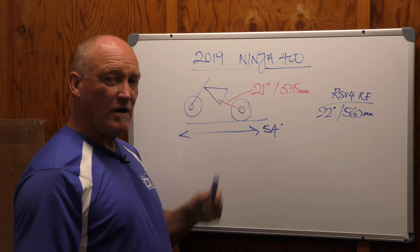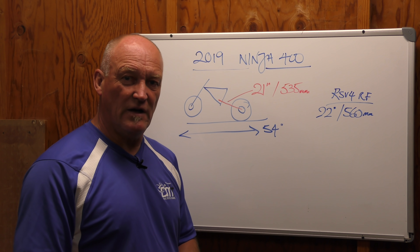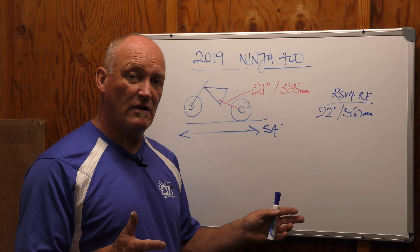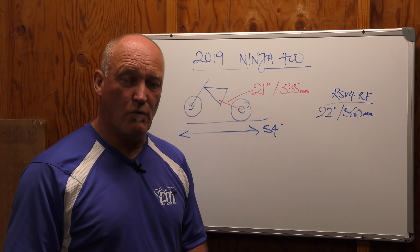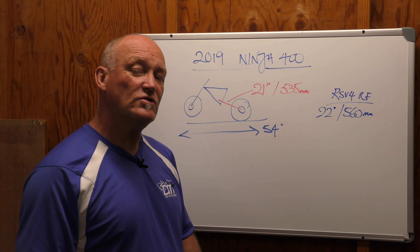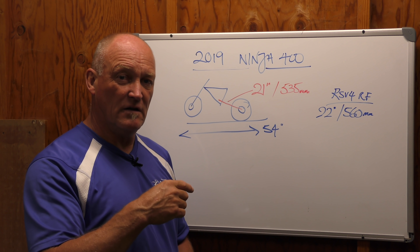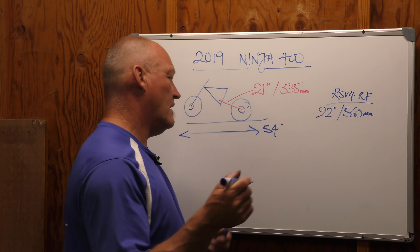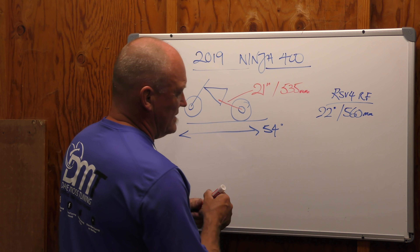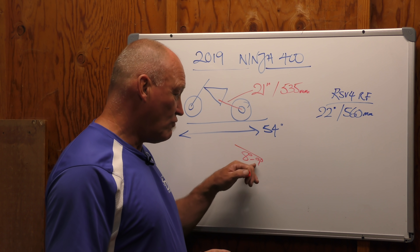So the position of the axle in the swing arm is a very critical factor you need to be aware of. Rule of thumb — generally in the middle is always a good place to be. If you're building something for the track, you're looking at something that needs to be both agile but geared correctly. For that, you may need to go way beyond the stock chain and do something considerably different. With a low horsepower bike, a short wheelbase is fine because you can't put enough leverage through the swing arm and the shock working together to create an issue. That issue is that you never want your swing arm to go flat. Ideally, with the bike at rest, that angle needs to be somewhere between 8 to 9 degrees — then you're roughly in the sweet spot.